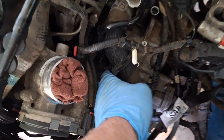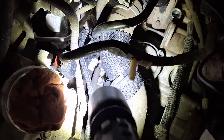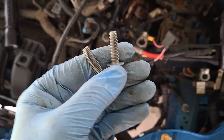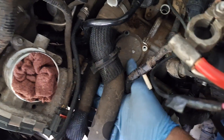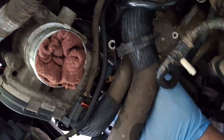It's getting to be winter time here. Next take the bracket bolts off for the shifter cable — there's a 10 millimeter bolt there and there on that bracket. Get an extension with a 10 millimeter socket; they both came out easily. Double check your cable is out of the hook, then slide the shifter cable plate underneath the hoses and get it off to the side.